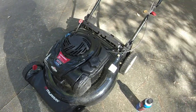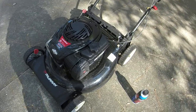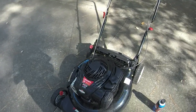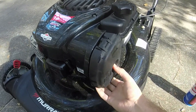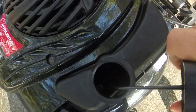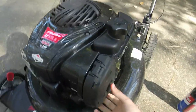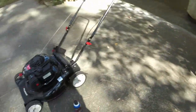A lot of this happens usually after you have the mower sitting for a little while and you leave gas in it — say if you let it sit for the winter and then get it out in the spring. It's a no-start condition. I do customer return mowers; you can follow my channel for other videos on that. This one here — you take it to prime it, there is gas in it, good gas came straight from the gas can that works great in another mower. You prime it up and it may crank, may not, and run for just a couple of seconds.